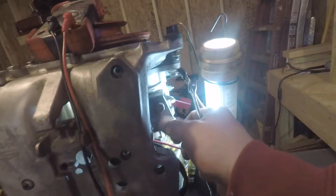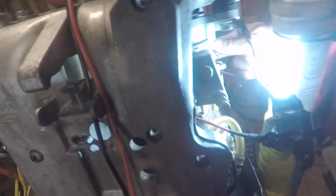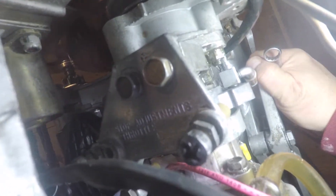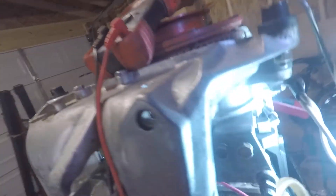This is your idle stop — right now I've got it in pretty far, probably about halfway is good. Then you've got the throttle stop, which right now is pretty good because you can't pull it any more. That's the full length of travel, so I'd say it's fine. If we need to adjust the throttle later, that can be done.